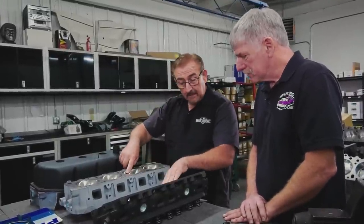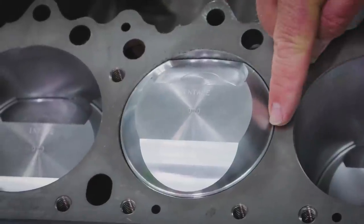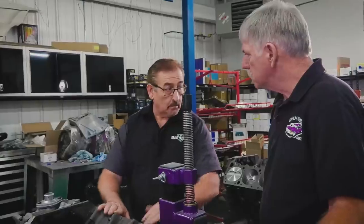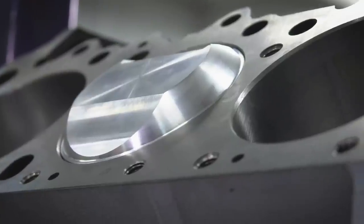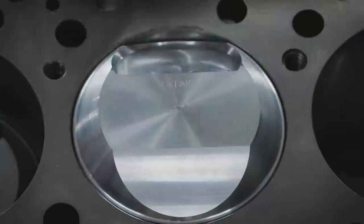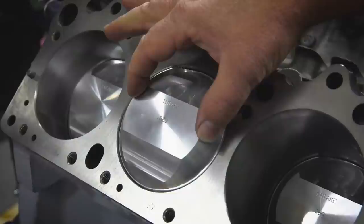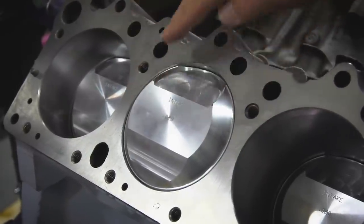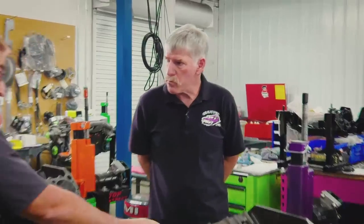Let's talk about the dome piston and the flat piston on the wedge. On the Hemi, you see how high that dome is — this thing produces 10.25 to 1 compression ratio. Our 440, being it's a six-pack engine, uses a different piston than a 440 Magnum. The height is different, and that ends us up with the 10.5 to 1 ratio — so the 440 actually has higher compression ratio than the Hemi. They brought the height of the piston all the way up, and it fits up inside the dome of the combustion chamber. If it didn't have the fly cuts, the valves would just punch holes in the pistons. The finish height of the piston plus the stock CC heads plus the fly cuts gives you the compression ratio of 10.5 to 1 — which is also a much sexier looking piston.